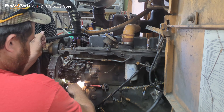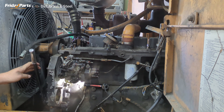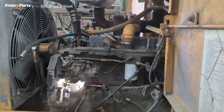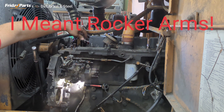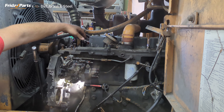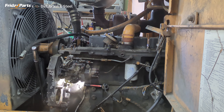I'm going to hold pressure on it — and there it was. That is now poked into the cam gear. Our valves are loose. I actually think I need to adjust the valves on this engine; that seems a little too loose, but that's fine for now — we'll deal with that later. Everything is now locked on top dead center and we can proceed with taking the injector pump the rest of the way off.